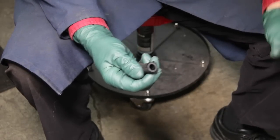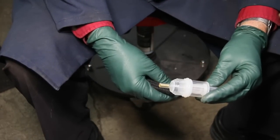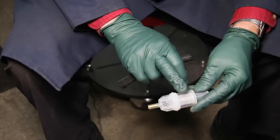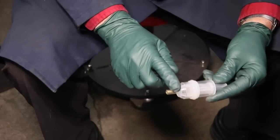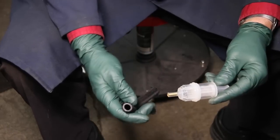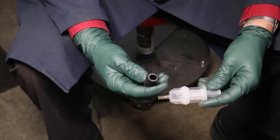I wanted to use one of the pre-filters common on the diesels — you can see through it because it's clear, and it has a very fine micron mesh. But look at the problem: how are you going to take the end of this, which takes an 8mm / 5/16 inch fuel hose, and clamp it down on this large fuel hose? It isn't going to work — you're going to have fuel leaks.